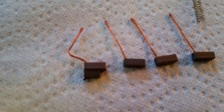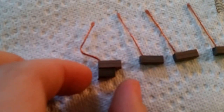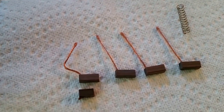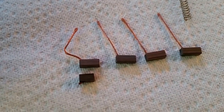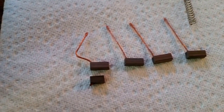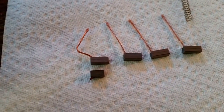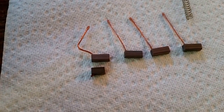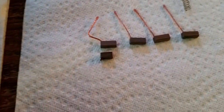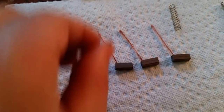You can see on this brush it's about halfway through its lifespan. There's about two-thirds of this brush that would be usable before it would stop making contact and start giving problems with the motor. And out of those two-thirds, half of that two-thirds is gone. So the old brushes had about half their life left. These new brushes should be completely full in terms of lifespan.